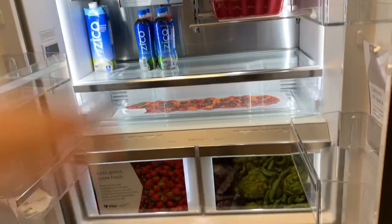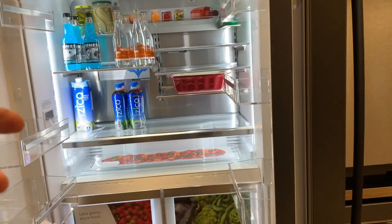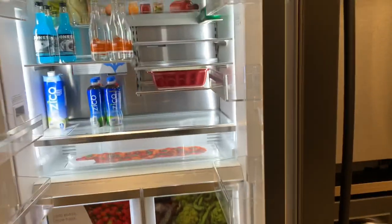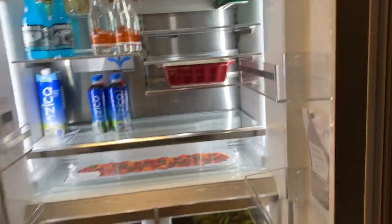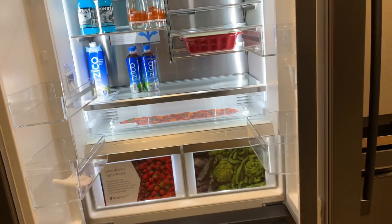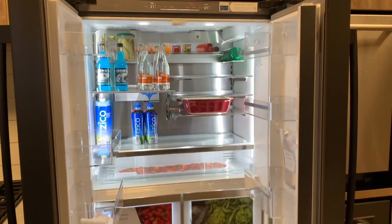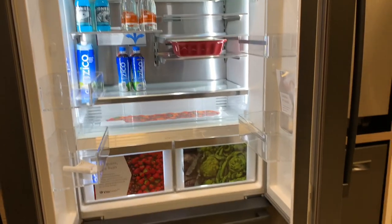With a built-in Sub-Zero, which has two separate cooling systems — two evaporators and two compressors — the humidity in the refrigerator is a lot higher. That evaporator may be at a much warmer temperature, probably in the 20s or 30s, and consequently your produce will live two or three times longer with all that extra humidity. So if you're buying a lot of fresh produce, that's a great investment. What's unique with the Bosch freestanding counter-depth refrigerator in these 72-inch-tall models is that they do have dual compressors, according to Bosch. They're made in China and relatively new, so we don't know the long-term reliability, but the price point is fairly reasonable — it's a great value.